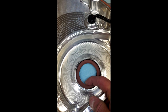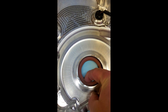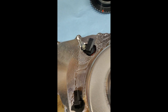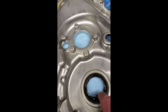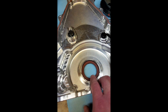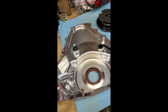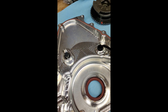I upgraded to an LS3 seal — I know it feels like going backwards in time, but this LS3 seal is much, much tougher. It's thicker; you can tell it's just a better-made seal. I'm not exactly sure why the engineers decided the flimsier style was better, but everybody essentially upgrades to the LS3-style seal and it makes a much more reliable seal around that pulley assembly.